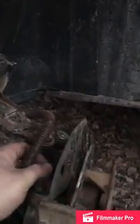Next thing you want to do is loosen your two bolts for your caliper. You have one down here and one up here. I've replaced that one, so it's stainless. So once you remove those two, your caliper will just slide. Well, I say it will. Might have a little dirt in there. You know what it is? Ooh, my mistake. I got my brake on. At least it works, huh?